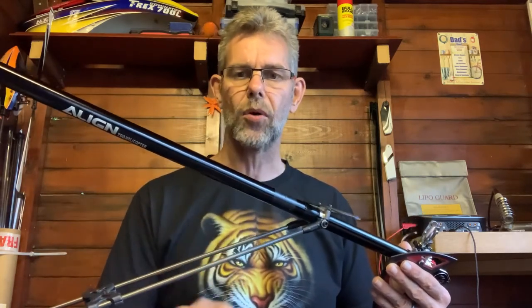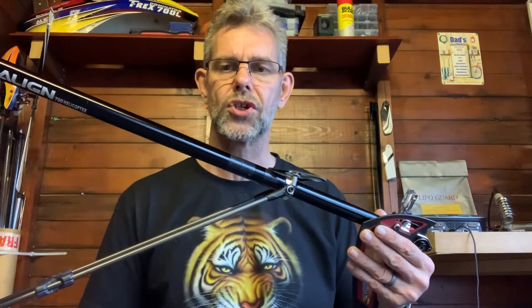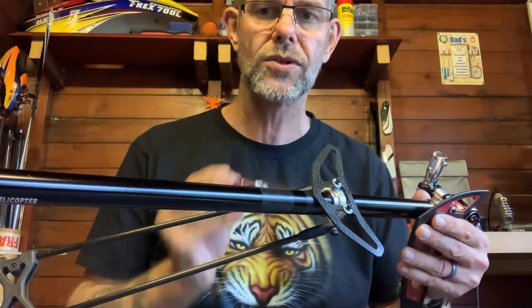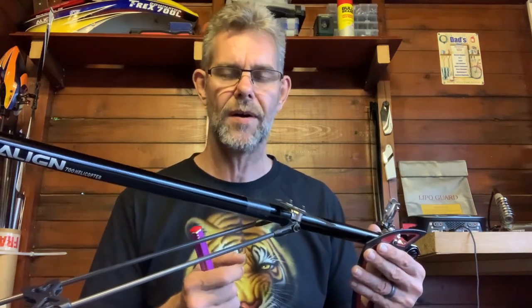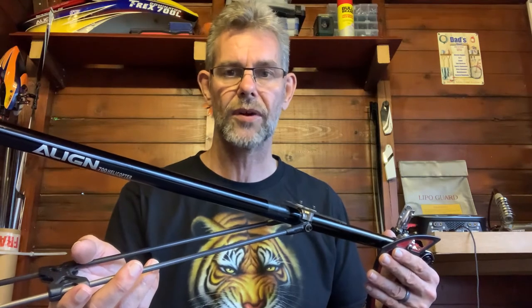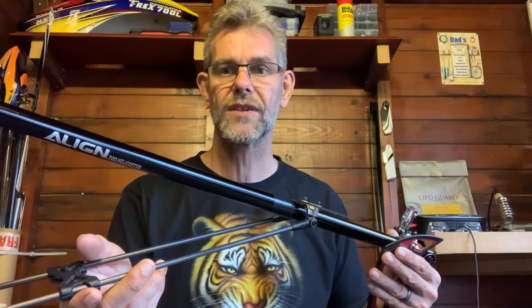The side bolts that you can see here, and one on the other side, will pinch the torque tube, as well as the two bolts that you do up here. Those two will clamp it onto the torque tube, and the two bolts either side will pinch it. This can cause damage to the torque tube, but it's pretty much a design flaw. Even the manual tells you to use some abrasive material and use tape, etc. So all I've done is put some masking, some electrical tape there, so that when I position that, it's not going to damage the torque tube and therefore have any other knock-on problems with the torque rod alignment and so on. Right, let's take a look at this front drive.